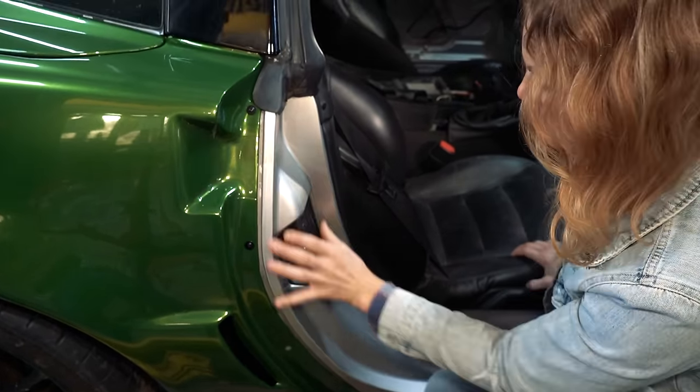All right, so this can be mounted in there just like this. You'll have one bolt right here. It's a Torx. And one right. Take those two screws out. And on the back, you've got a plug right there, two plugs right there, and this kind of goes in past the steering column a little bit, but you can get it without removing anything else. Take those out, put the new switch back in, plug it in, put those screws back in it.